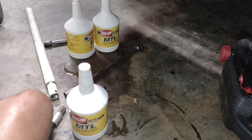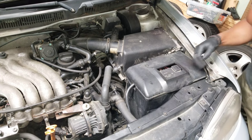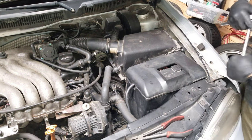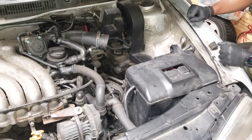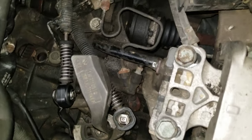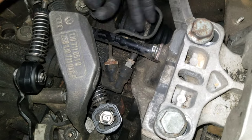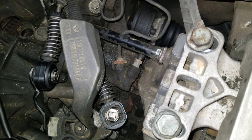I haven't decided if I'm going to bleed the clutch before I see if this improves things or just go ahead and bleed it while it's on the stands — but yeah, we'll bleed it now. To bleed the clutch lines I have to take off the intake again. I should have done this last time, but anyway. Now I can see it clearly: there is the clutch slave cylinder right there, and there is the bleed nipple right here. I'm going to call my wife out to help me bleed it.